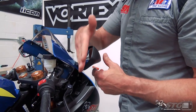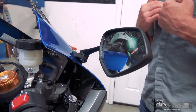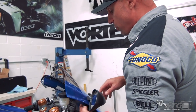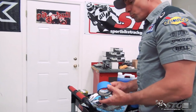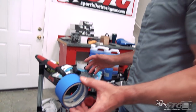That's not even close to being it - there is more. Mirrors: you can leave them on the bike if you want to, but you have to tape over any of the glass surface on the mirror itself. I'm going to remove the mirrors and use some zip ties. Once I pull the mirrors off, I'll run cable ties through there just to hold the upper to the fairing stay. I'll also pull the fuses for the headlight as well as the tail light and tape over them. Blue painter's tape works phenomenally - it's easy to get off and won't leave any residue on the lights.